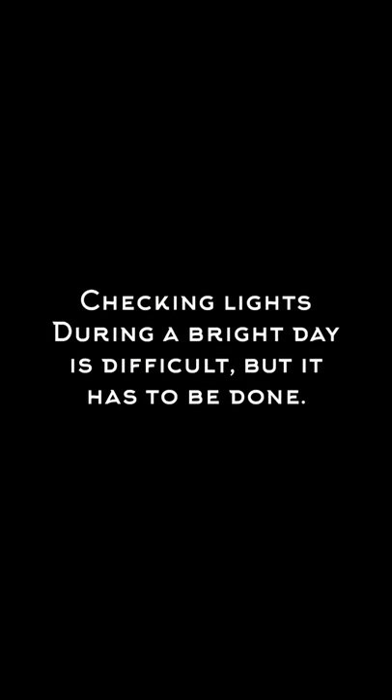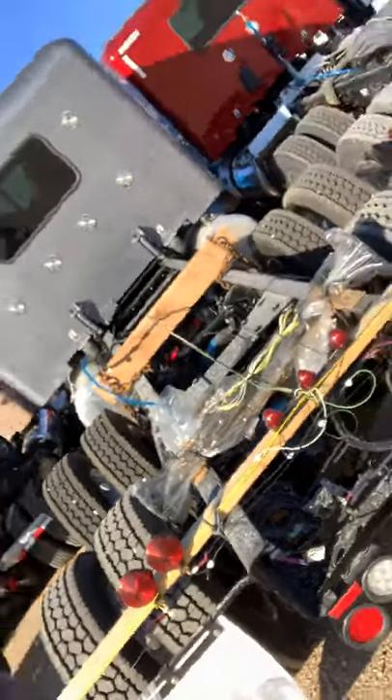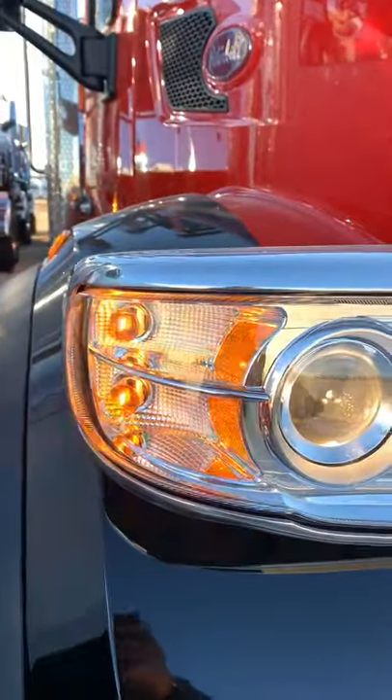I have already gone around and done my pre-checks and tightened all the bolts. I'm going to walk back behind what I've already done and show y'all, so it's a little quicker. Right now I've started the truck up, turned the headlights on and the flashers on. On a four-way you will have these little marker lights on the side - two on each side. Make sure they are illuminating. Then go back and check the tail lights and the blinkers - the lights are flashing. Check the front blinkers and headlights as well to make sure that they are working.